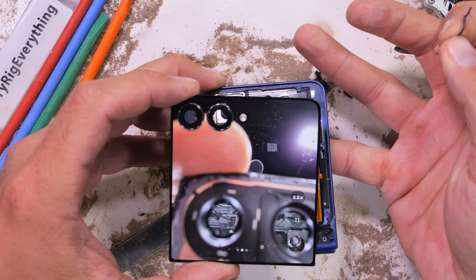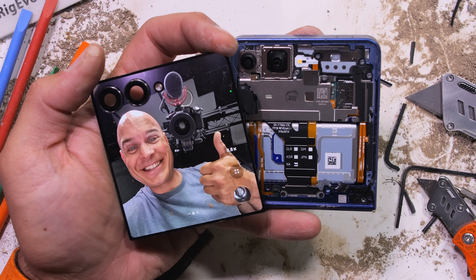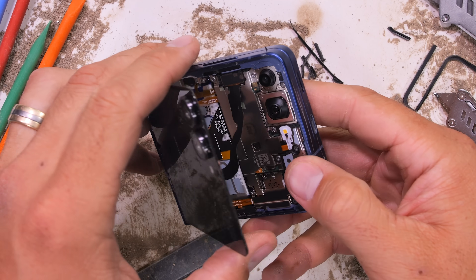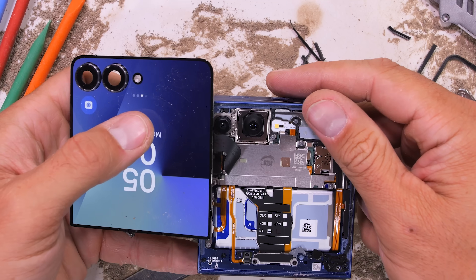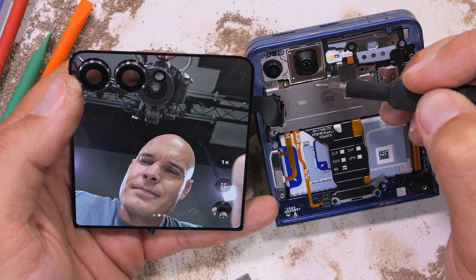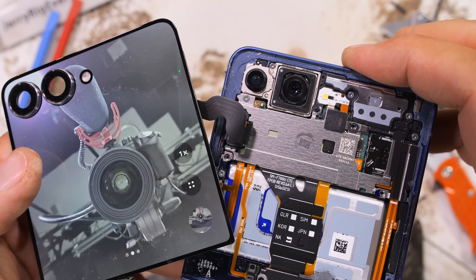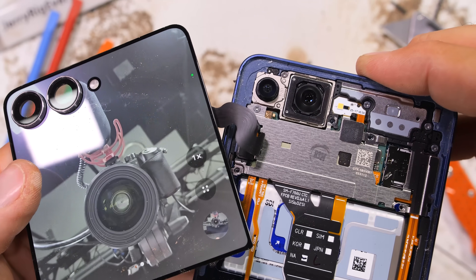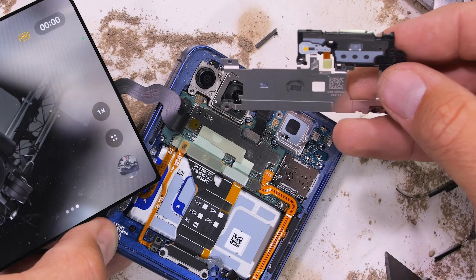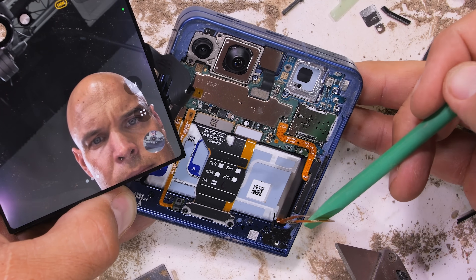The internal ribbon cable sits slightly inside the left edge of the screen and is long enough so that the whole edge-to-edge display can pull away from the Flip 7 body. I still don't see a way to turn off the phone from this exterior little screen, so we'll just have to continue the autopsy while the patient is awake. I'll remove the 8 Phillips head screws from the upper protective bracket. We can also get an inside peek at how much travel the optical image stabilization on the main camera lens has — as I tip and shake the phone, you can see how steady that image remains while the tiny electromagnets inside the camera body physically stabilize the lens. With the screws gone, the back metal can pull away, still attached to the upper loudspeaker and earpiece. And if we look very closely, we can figure out which wire goes to the battery, which finally puts our Flip 7 to sleep.